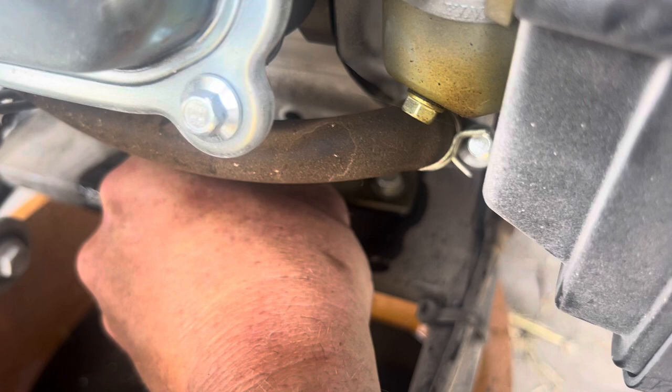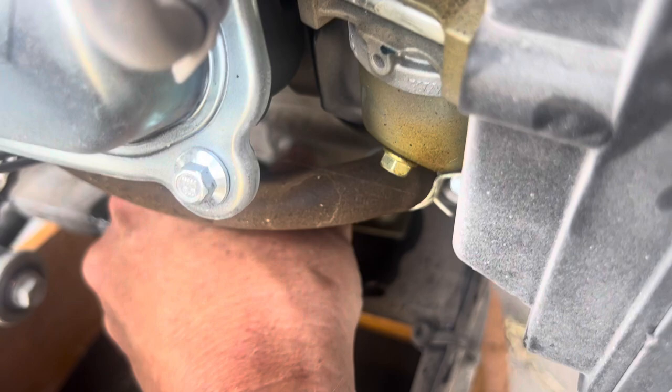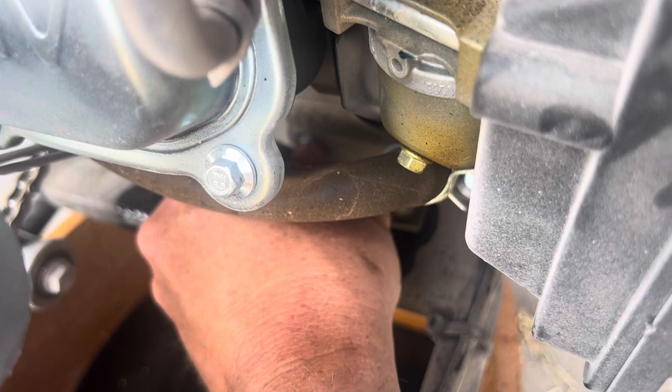It's already done draining, just dripping off the rail. These things only hold about 0.4 quarts of oil, so not a lot — which is why it's pretty easy to change out, but also pretty important that you do change them. It helps these things run a lot longer.